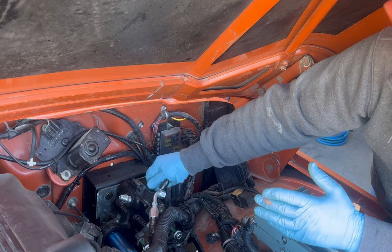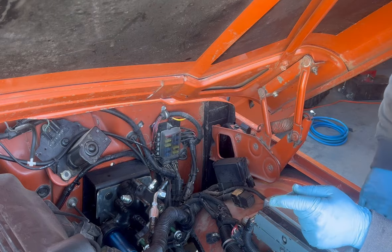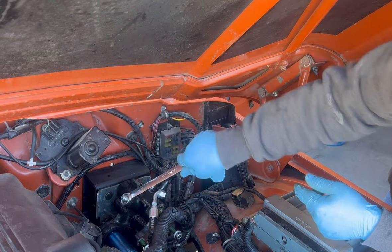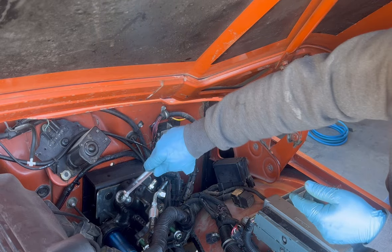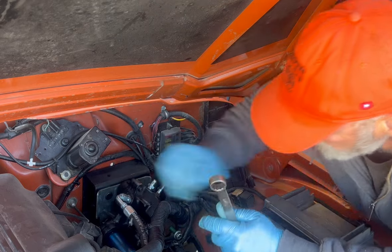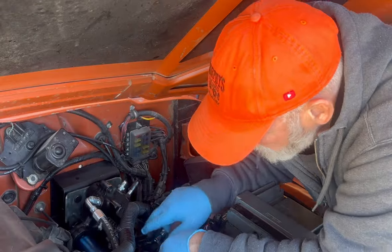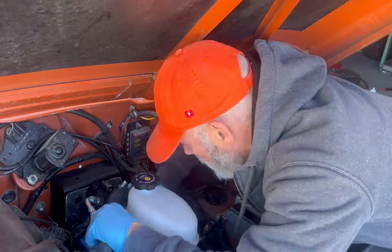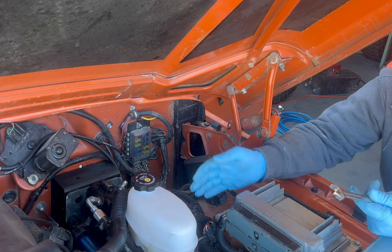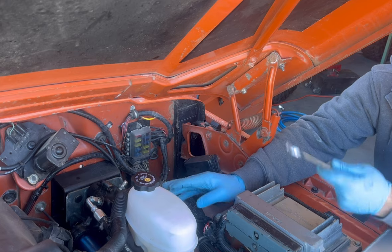And you can see I'm putting it in. The adapter and the HydroBoost will go in first. And then I'll mount the master cylinder. But do I replace the master cylinder and put new lines in it, or just the new master cylinder? I'm gonna wait to put these lines on until the master's in, just so they're out of my way. All right, next. Looks like I've got plenty of room and they'll line right up, but I'm hesitant on using the rear line. It's a way bigger volume. If I make new lines, I don't have to use an adapter.